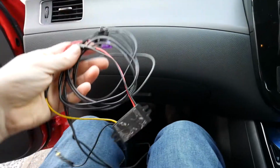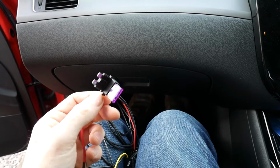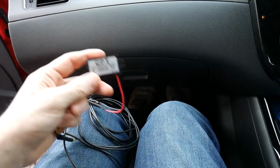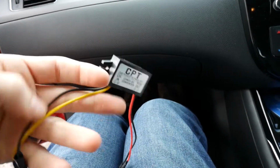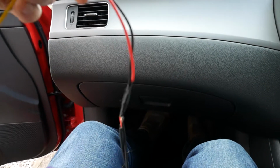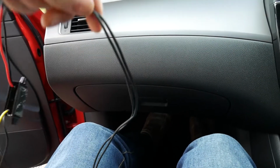So basically this is the wiring kit I had in the Leon. That's the add-a-fuse, but that's a standard size fuse. This Pulsar uses a mini or micro low profile fuse, and that's your step down. Essentially what you do is the 12 volt on this, which is this side, that's your earth, and then you connect the add-a-fuse to the power, and then on this side, which is the 5 volt, you just tape up or solder in, as I've done, the taping's poor, the power and earth cables for your hardwire.